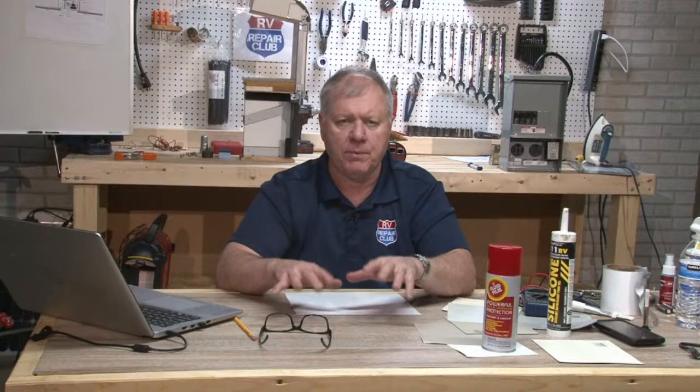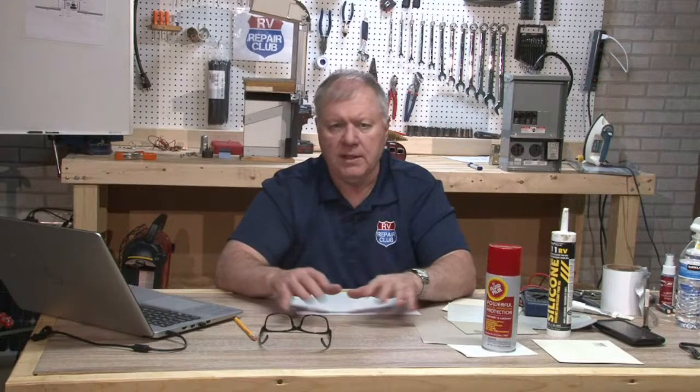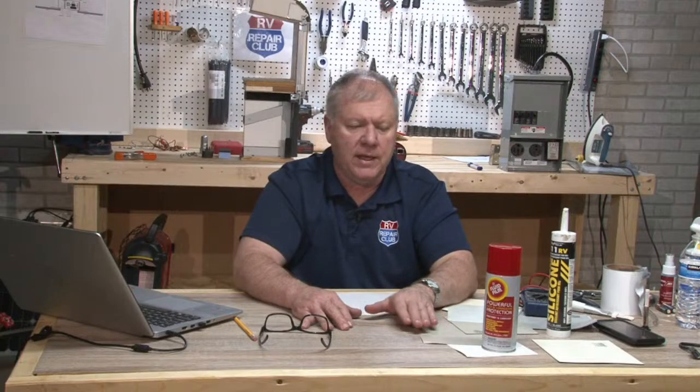And if it starts jumping around and flickering a little bit or orange, then you've got a regulator problem. So if that's okay, the next thing you would look at is, do I get spark when I go to try and light it up on LP? Do I get a click? Do I hear the valve open? Is gas coming to the burner assembly? Do I hear a spark? Do I hear it trying to light?